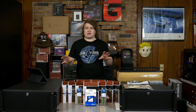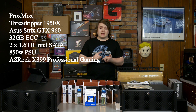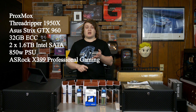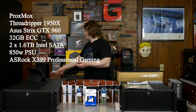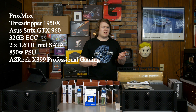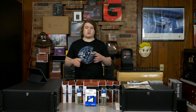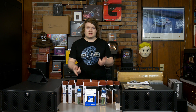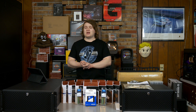To go over the rest of the specs rundown - let's say this is the current Proxmox machine - it has the dual 1.6 terabyte Intel SSDs. It's also got a Threadripper 1950X with an ASRock X399 Professional Gaming board. I'm using Noctua coolers on everything - you can tell I'm a Noctua fan, there's literally a pile of Noctua boxes going all the way up right here. Same cooler on both builds actually - the NH-U9, the TR4 edition. It's a really thick, kind of short heat sink that fits smaller fans, and it will fit in a 4U and maybe even a 3U case. ECC RAM - two 16 gig sticks in each, so 32 gigs total. Eventually I want to max that out or at least get up to 64, but for now 32 is functional.